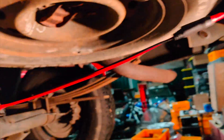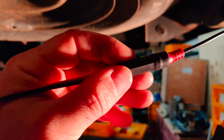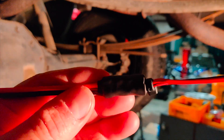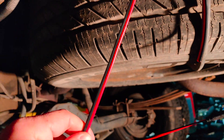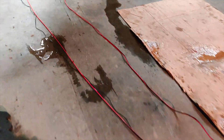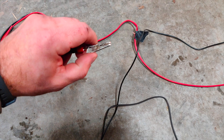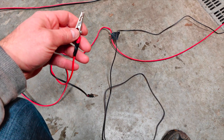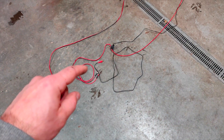So I got the wiring started. I connected that five and a half millimeter end that's connected here. I have a little bit of heat shrink over it — I haven't shrunk it yet, but this will help hold it together and keep it a little bit more weatherproof. Same idea with the video feed. And then this is just the connection to that red and black wire, and then I have another red and black wire here for the light. I have all of those running up to the front. I put just some alligator clips on the one that goes to the camera so I can power the camera and then turn on the monitor and just make sure that it's working and that the video feed isn't upside down. Let me lower this down, get that hooked up, and then we can check the video.